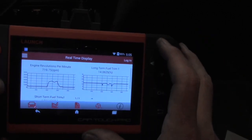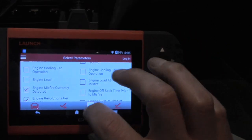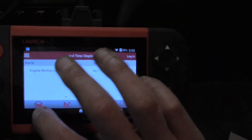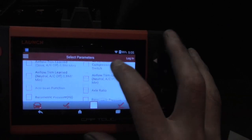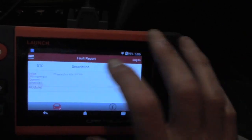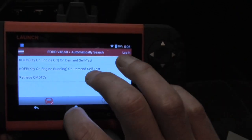We will do another video where we will use this tool to actually diagnose what is wrong with this car. But we can confirm very clearly that that is not a vacuum leak. What I want to do is go back and look for misfires, because right now this car is running terrible. Let's go to the engine misfire count, clear everything else out — I'm just interested in that right now — and see if we can catch some misfires. No. Actually it would be showing current misfires right now the way it's running pretty rough. Let's go back and read the fault codes — no fault codes. So that is interesting. This is definitely an engine problem though.